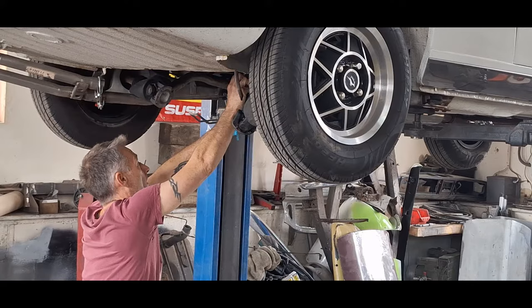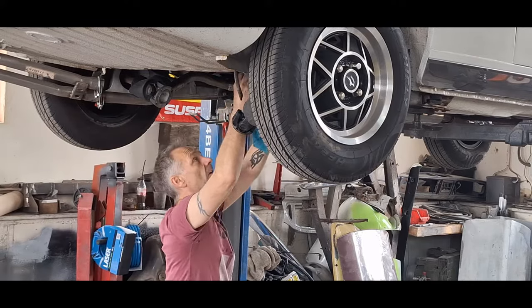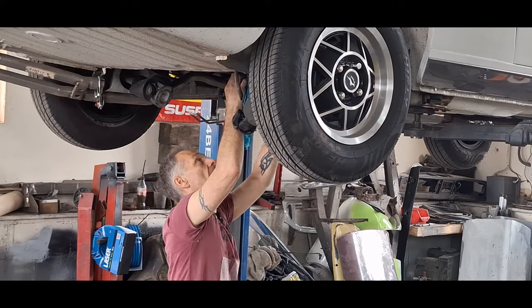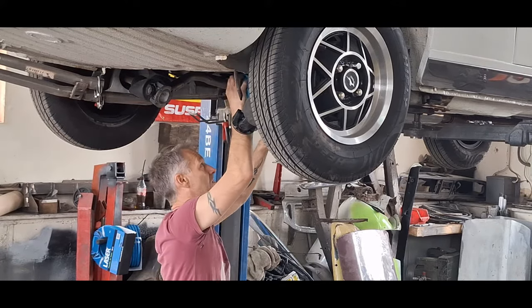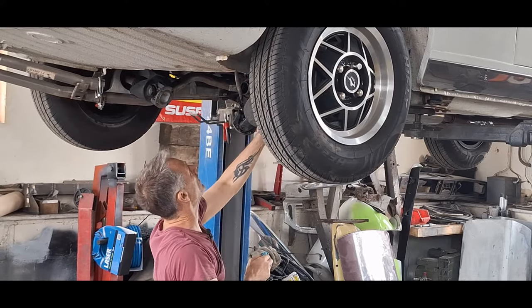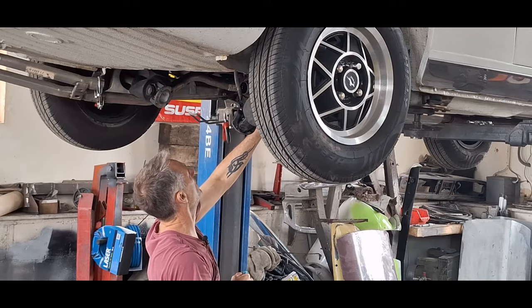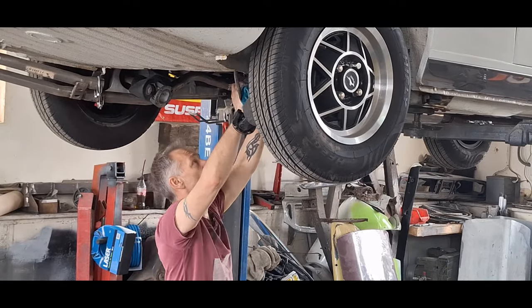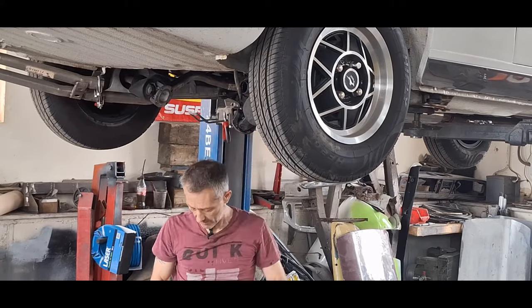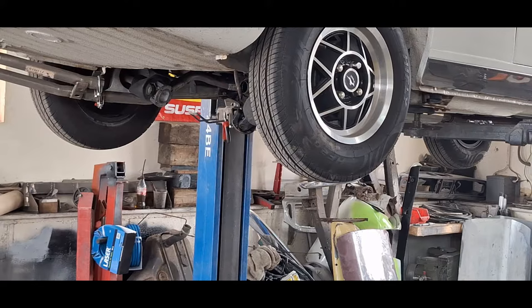I've checked it for lift - feels lovely actually. I changed this quill shaft when this car was first rebuilt; the rear axle was bent and his quill shaft had loads and loads of play in it, so I bought this one and put it on. I was checking if there's a king spline in there - if you don't know what a king spline is, look it up, but it's basically a fatter or wider spline to make sure it locates in the right position. It doesn't have one. Although this is reconditioned, I'm going to give that a little smear and just make sure it's clean and there's no debris on it.